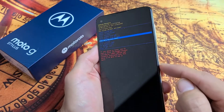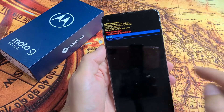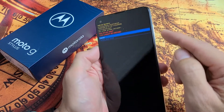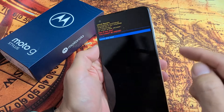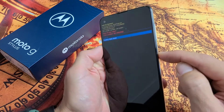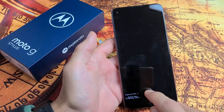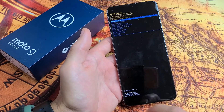Anyway, if you want to proceed, go to Wipe Data / Factory Reset. To select it, press the power button. Are you sure you want to do this? This cannot be undone. So I'm going to go ahead and go down to Factory Reset right here — this is going to erase everything on the phone. I'm going to tap on the power button to select it. This whole process will probably take one or two minutes, and it says Formatting Data.